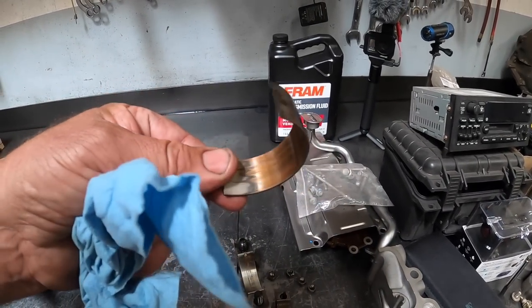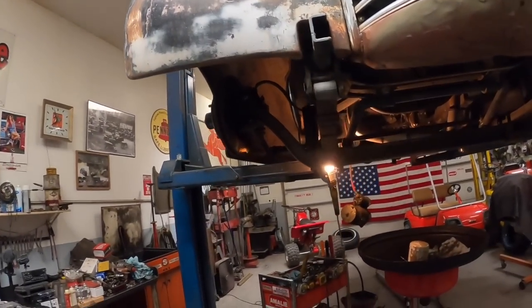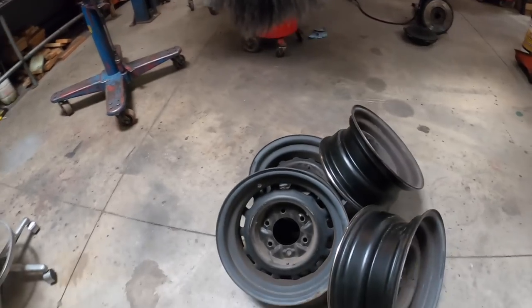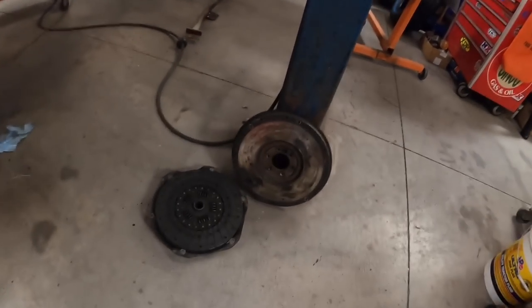That way they oil better, because they don't look like they're oiling very well. This engine's always had really good oil pressure — runs 100-plus on the oil pressure — but it's just not getting in when it needs it. So we'll order some parts. The wheels are going off to powder coat. The clutch is trashed. You can see the high spots — it's just garbage.